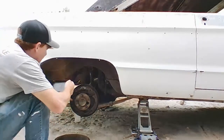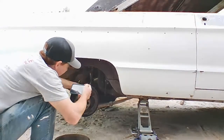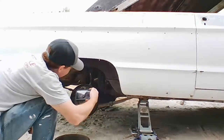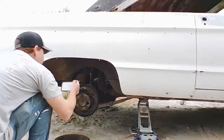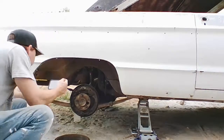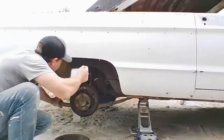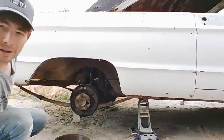Now, I thought this is neat. This is a little bit different than what you see on the Fords. On the Ford, you have springs here and here. But this one actually has a short end here, and you got this hooked in. It kicks down. That's pretty interesting. But you can see everything looks good. We'll throw it back together. Go to the other side just to confirm. And if you look back in there, that hose don't look too bad either. So it'll just be a matter of checking the other brakes over there. It ain't broke, don't fix it.